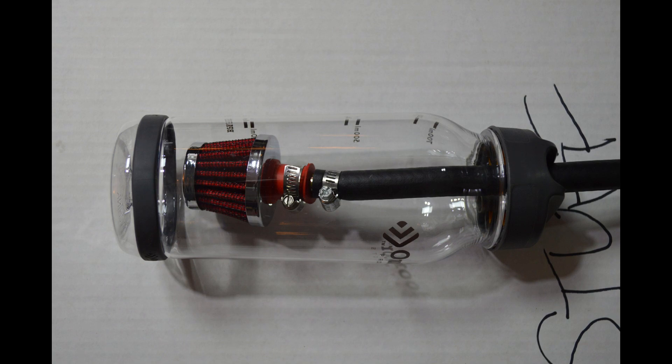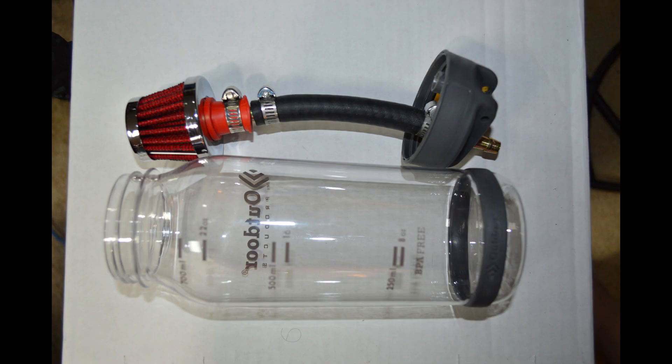Now that you've got that really frightening caveat, you may be thinking: what exactly to do about that? Well, there is a pretty cheap solution that a lot of people have done, actually humorously using a Toyota part. There is one with a Nissan part number as well, but I chose not to use that because the barb part of the fitting, even though the thread was the same, the barb was a smaller diameter, and I wanted to make sure the hose was the biggest possible.